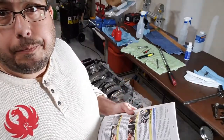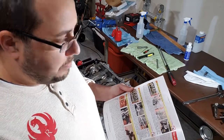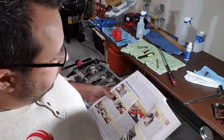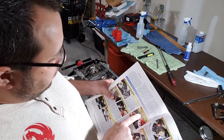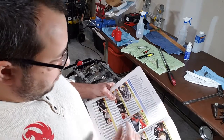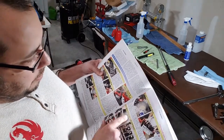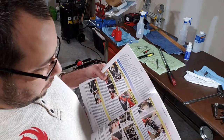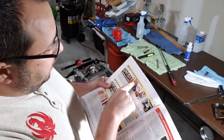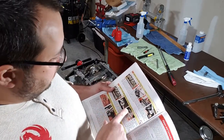All right. So here we are, final assembly. We've done, we installed the screw-in engine block plugs. We installed press-in plugs. We installed the main bearings. We put the crankshaft into the block. We installed the main bearing caps and bolts. That's all done. Everything's torqued. We tightened the inner main bearing cap bolts. We tightened the outer main cap bolts and side bolts.